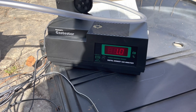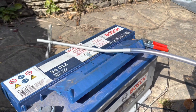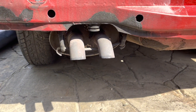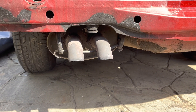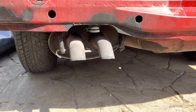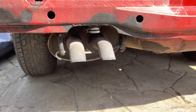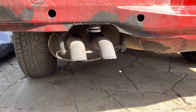We're nearly at our eight minutes. It's reading 1 on the gauge, with the probe just resting on top of the battery. The engine has been idling for the same amount of time — it's reasonably stable at around 750 rpm, which is where it needs to be for the test. Just from the smell, that smells like a very rich engine to me, so I'm expecting the CO to be quite high, but let's see.